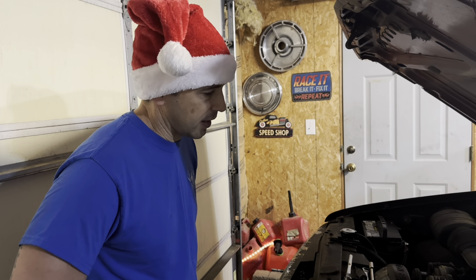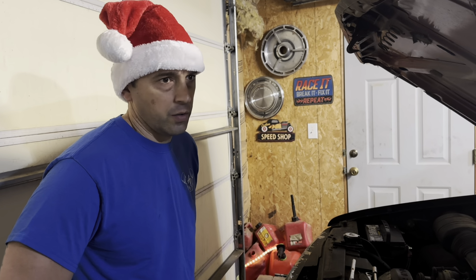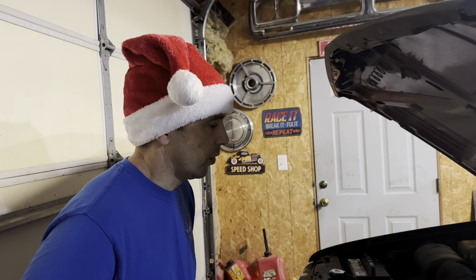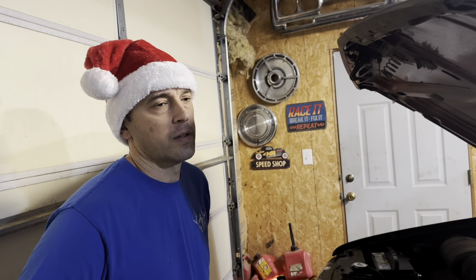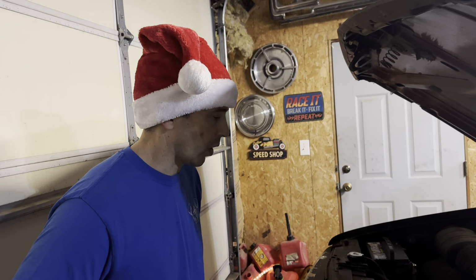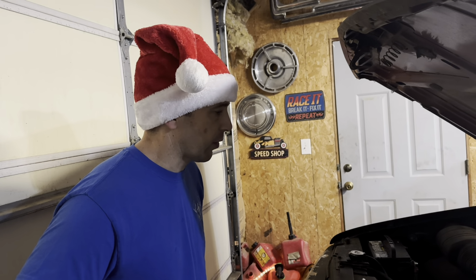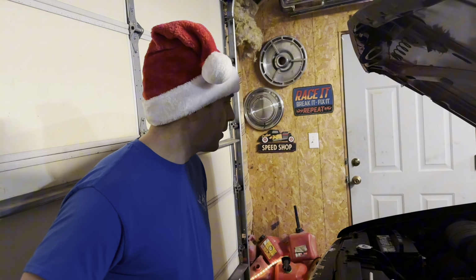We're going to start by taking the exhaust out because he's got new thrush welded he's going to put on there. So he's just going to have a whole new exhaust system, and instead of the 2-in-1 like the factory has, we're going to do 2 straight pipes, pretty much straight pipes out the back. So it'll be a little throatier, maybe give him an extra 4 horsepower or something. All right, we're going to get started.